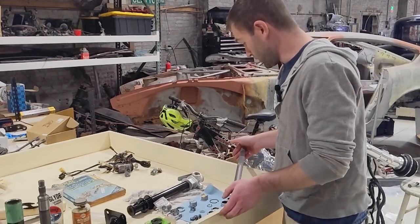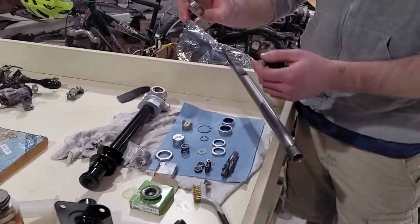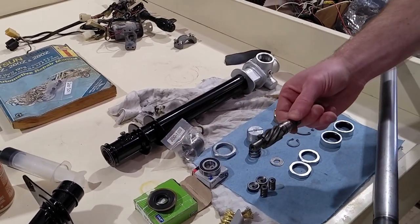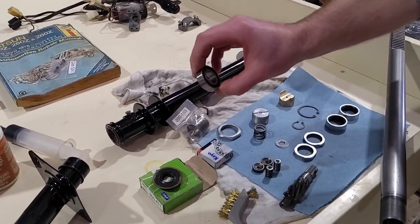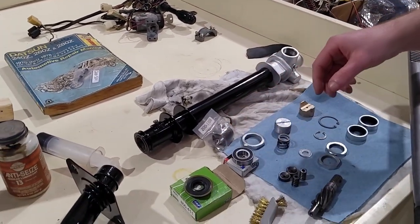And we are going to install those things pretty soon here. So, pinion bearing, again, Z-Car Depot sells them, replaces the old pinion bearing. Good thing to replace while you're in there because the originals were not sealed. So if you ever got any water into yours, it can sit in these, corrode them, cause issues.